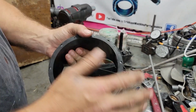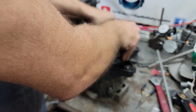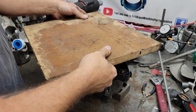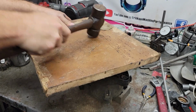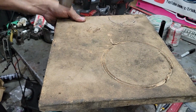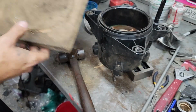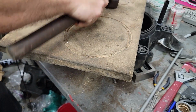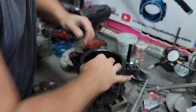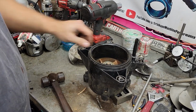So here's the wear ring. The flat side goes in, the round side is in the opening. So just set it in carefully. And then I just take a board and kind of beat it in. A little love tap over here. Perfect. We are all the way home. Now let's blow this all off, and now the wear ring's all nice and new, ready for a new prop.